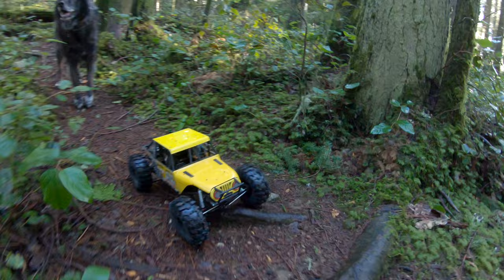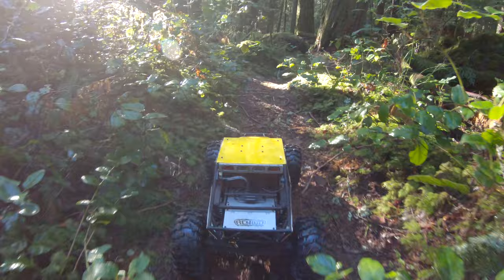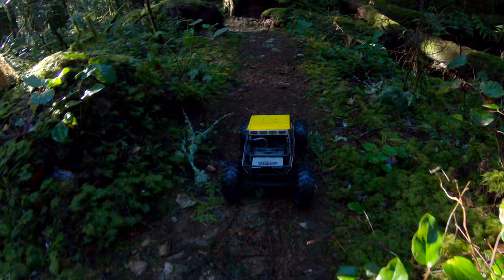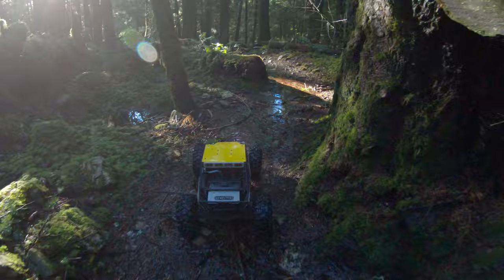From what a friend was telling me, it's all those servos, because when you have your rig fully locked, the servos are holding the whole time. So I need to get a BEC to help with the amperage, and then that won't be an issue anymore. So easy enough. I don't just do trail running, I like to do rock crawling, so we've got to adjust the rig accordingly.